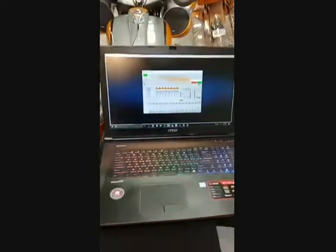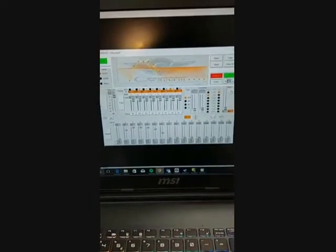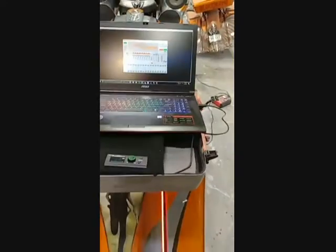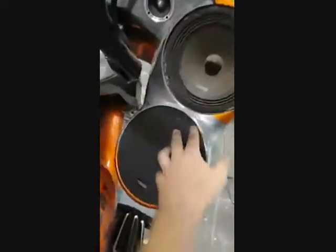When I say that this thing gives you a tune, that's what I'm talking about. I'm not talking about just adjusting the gains on my amp and setting my crossovers to high pass or low pass, or messing with my radio and setting the EQ across the board — because that's what you're doing when you have an aftermarket head unit and you're setting your frequencies from say 80 up to 20k on a 7, 12, or 13-band EQ. That's adjusting it for all of your speakers, across the board. You're setting a wide-band EQ all the way across.